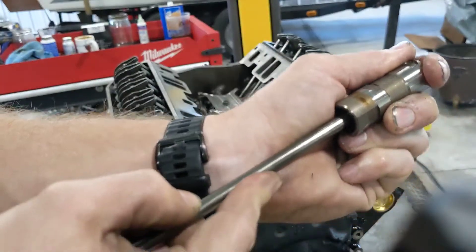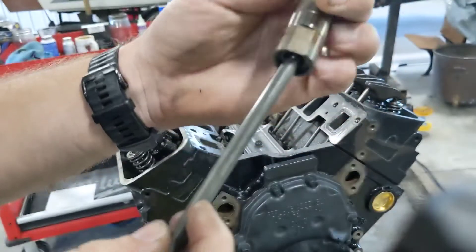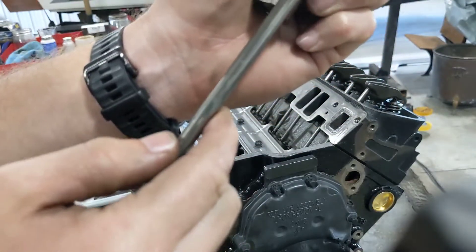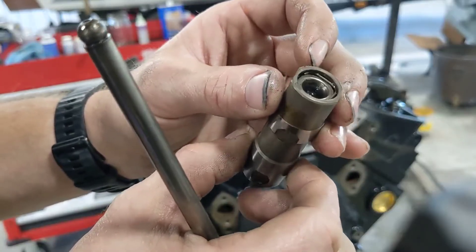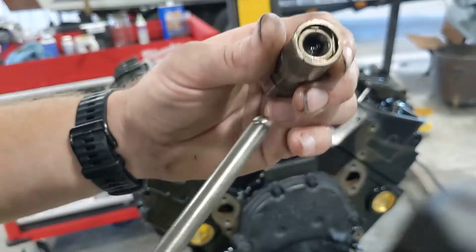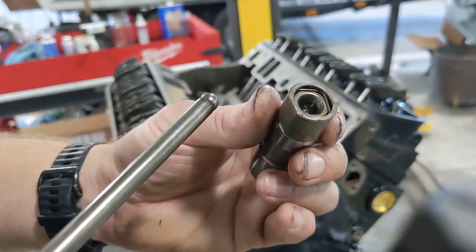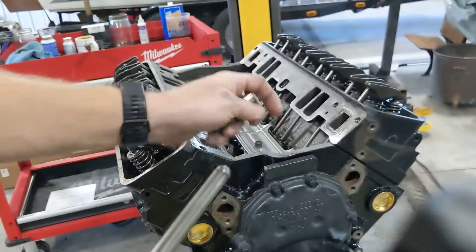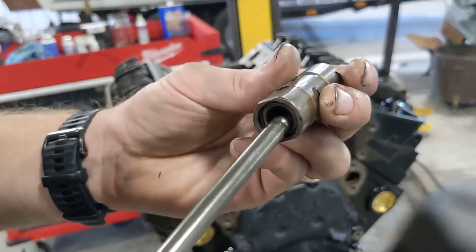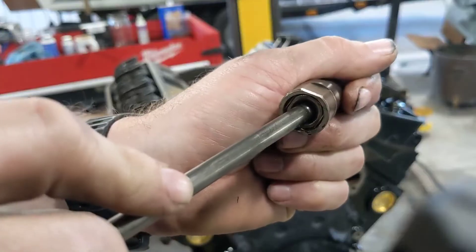What I've got now — if I push on this, that spring in there has play. The push rod is going and pushing that piston up into that lifter. There's a retainer clip — see that retainer clip? — that keeps that piston from popping out. What we want is: when assembled in the motor, we never want that piston sitting on that retainer clip. That's only for assembly so you can get the lifter together and into the engine. After that, we want that push rod butted up against it. Right now all these lifters are still sitting on that retaining clip because all we've done is taken the play out — we stopped as soon as we made contact and the push rod is no longer popping around. But what we're going to want to do is preload it.